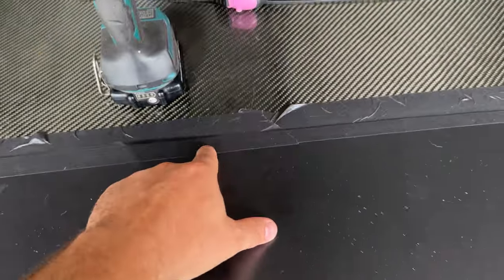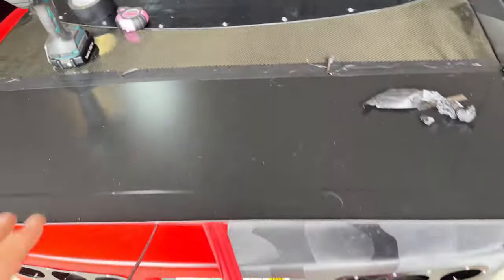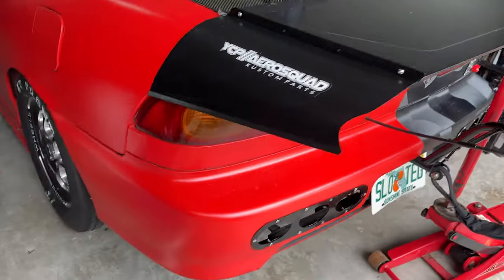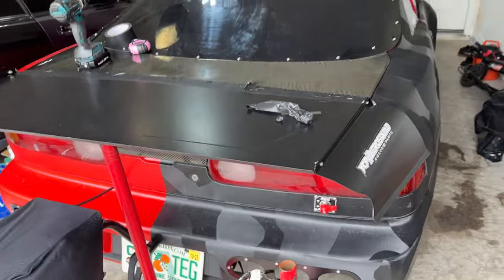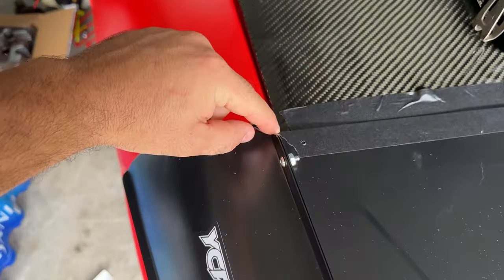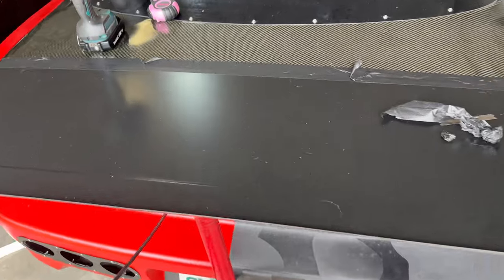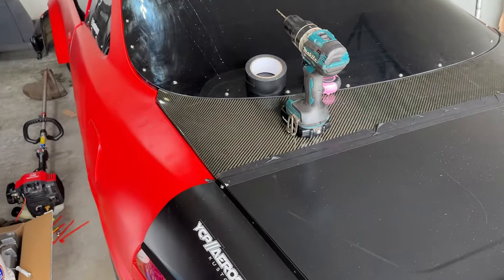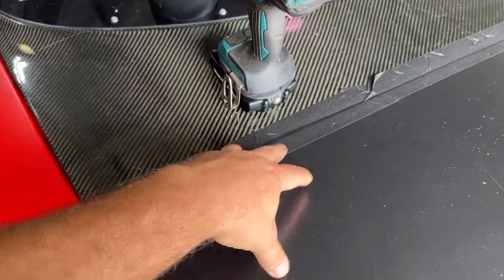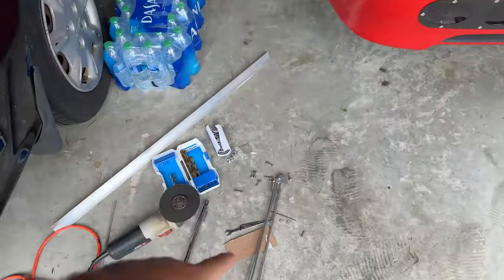The indented points in the tape show where it needs to be drilled into the actual hatch body — that's the alignment I figured out. I got it to a similar location on both sides of the taillight for the visual aspect, which I think best suits this body line. I used measurements from each end of the wing to the anchor points on the hatch, and they're within about an eighth of an inch. Once I have it bolted in I can take the tape off, keep it on the jack, and do quick measurements to make sure it's all good before mounting the rods.